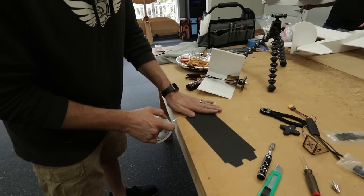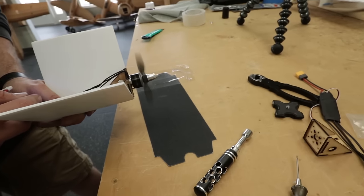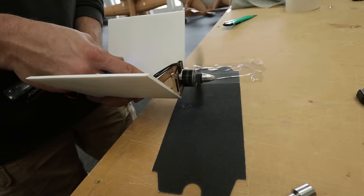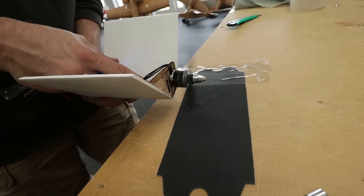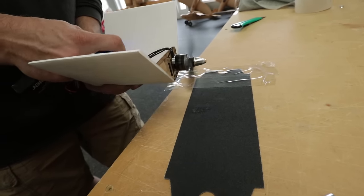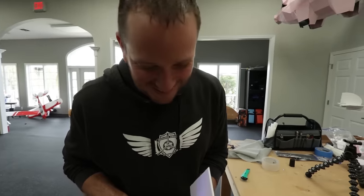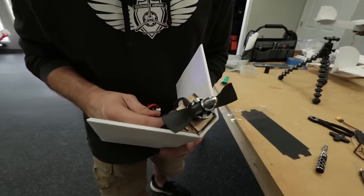In a normal world you're going to have a lot of vibration because the prop is just a little one way or the other. I'm going to show you a trick on how to use sandpaper to make it perfect on both sides. Now we've got a perfect angle on both sides and she's balanced at the same time.